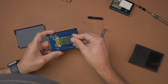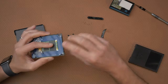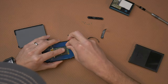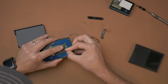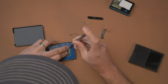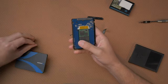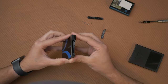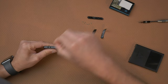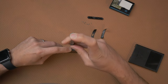So you just take the drive, line up the slots, push it in, and hold it down. This adapter actually comes with the screws, which is another reason I picked it — some of them don't come with screws, which is lame. Take the two larger screws and put them in the little holes for the mSATA. Screw them in with your screwdriver. Then take the top piece and put it back together. It's got four screws on the outside — use the two inner holes on each side, since the outer ones are for mounting in a PC.